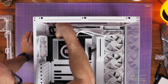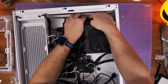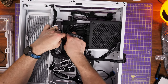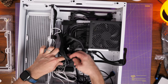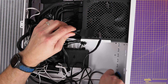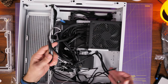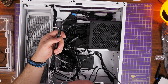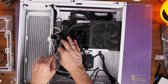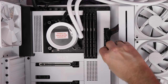Don't forget to plug in the CPU power connectors run up to the top. There are velcro straps along the top to hide and hold cables in place. Speed through tidying those cables down. Don't forget the SATA power connections for the pump head and fan controller — connect those to the PSU otherwise you'll run into problems. Now for the front panel connections — the blue one is USB-A and then there's USB-C. Run them through roughly where the 24 pin runs.